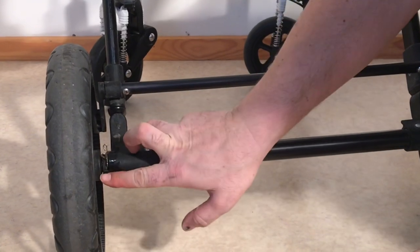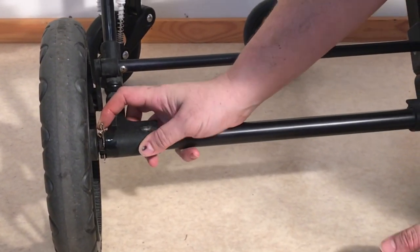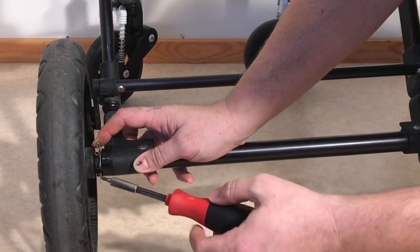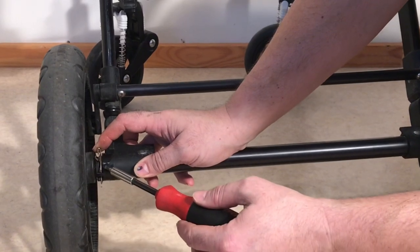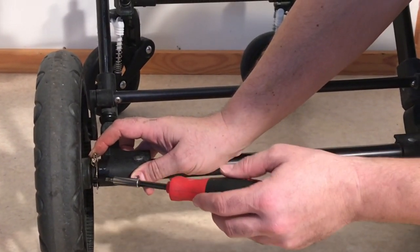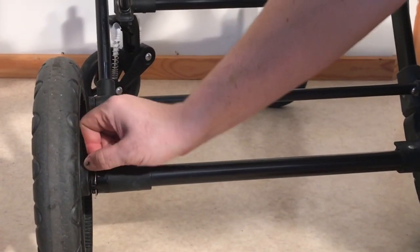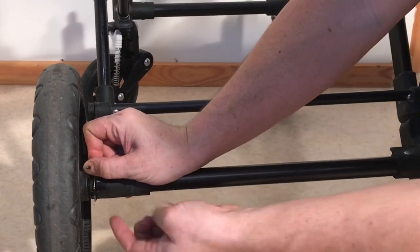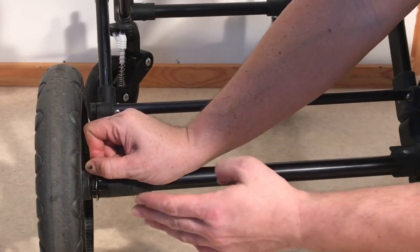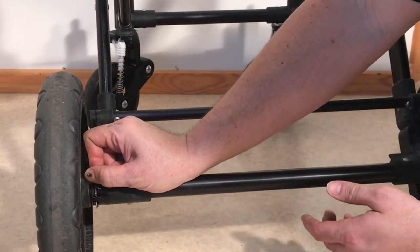In the middle there's a little plastic wall, and when you bend this out the pin is actually angled inwards like an elbow — that slots right in through a little slit and locks into the axle. What you're going to need to do is work this metal pin so that both of these angles, just one on either side, are pulled far enough away from the axle that you can get it out. You don't want to just start hammering it out because you can damage the axle and you can damage the pin.